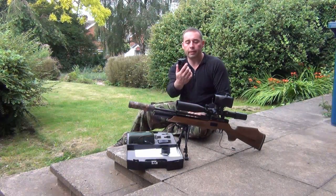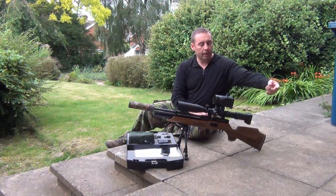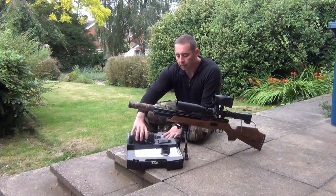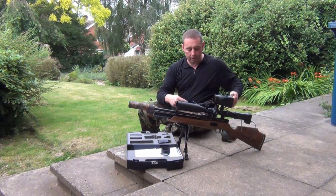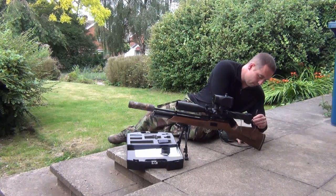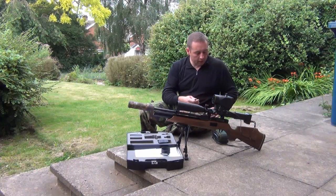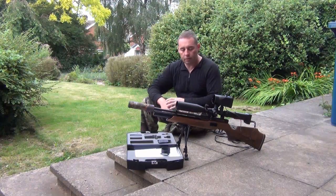Next thing you do is take out the camera itself, and the camera unit just fits straight into the backlight. And then the lead, which attaches to the LCD screen, just fits into the back of the camera module. Finally, the last thing you need to do is take out the battery and the external lead, what I use here, the extension lead. Plug that into the back of the camera module, and also the other lead I bought and purchased myself to allow me to record, and that just then all fits together, and that is the unit now ready to go.